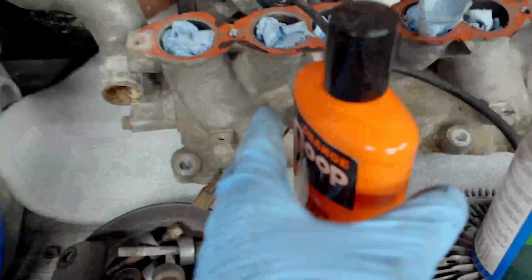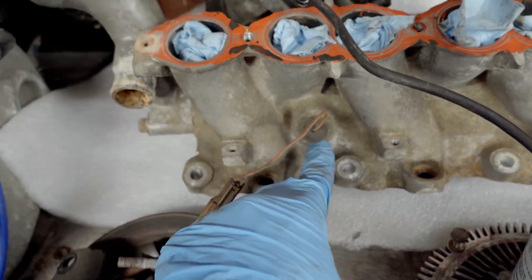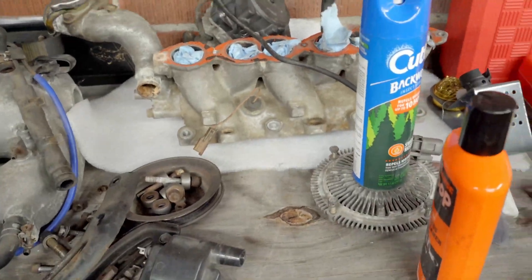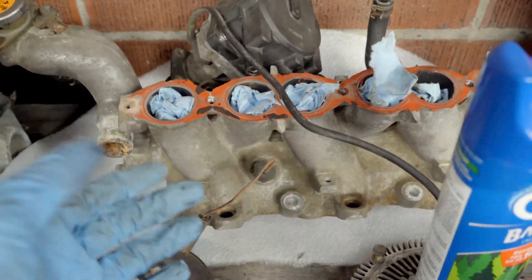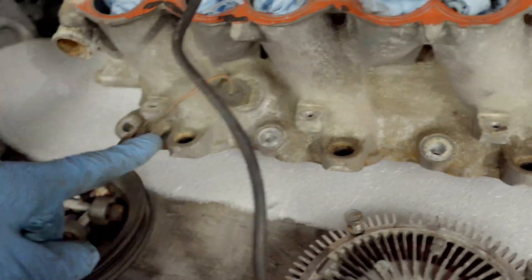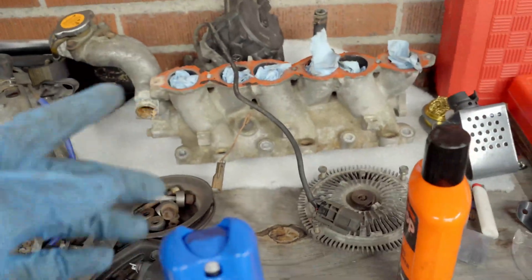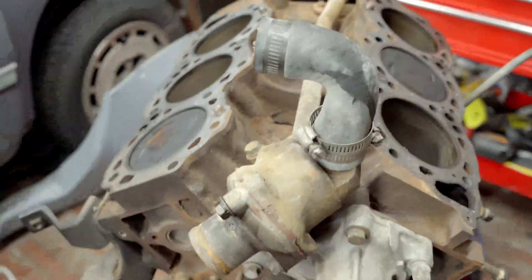There was one sensor in here — here it is. From what I saw it's a coolant temp sensor, but the literature says it just pulls from the block, which I'm not 100% sure about because it's plumbed in here near the intake runners where the heater core fluid comes through. So I don't know if that's actually correct. If it is, cool; if not, we might tap the front of this and put a coolant sensor there at the main water outlet.